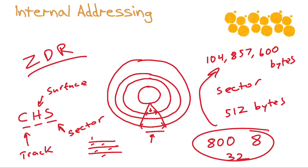This internal addressing on the disk structure is established during what we call a factory format — also known as a low-level format. This is not what we do when we format a drive from an operating system. That is a logical type of formatting, as opposed to this factory format where the internal addressing structure is decided.